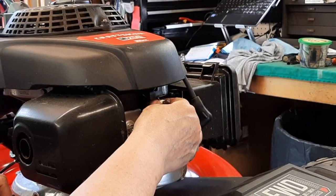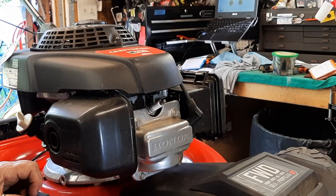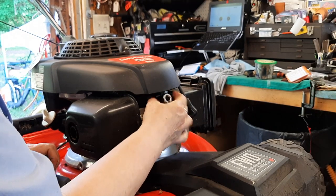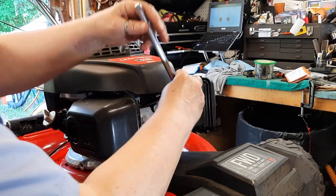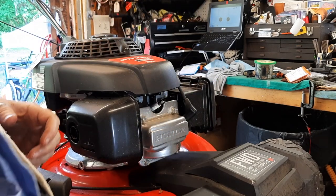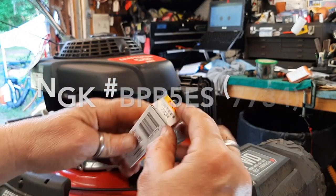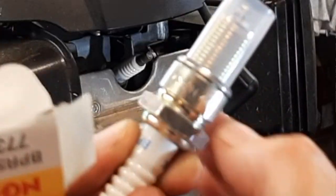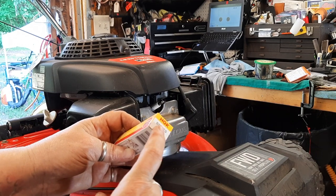Start this by hand, and once that's fully seated, use the back side — no more than one quarter of a turn. If I were going to replace this spark plug, I would be using a BPR-5ES. All we're really trying to do when we tighten this down is compress that crush washer. That's why you go no more than a quarter of a turn. Any further, you can damage the threads in the head.